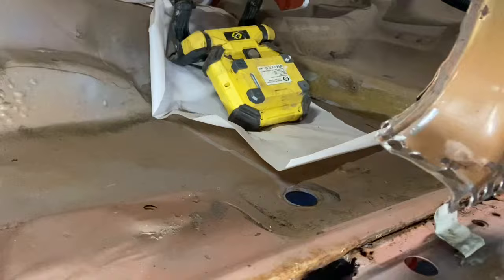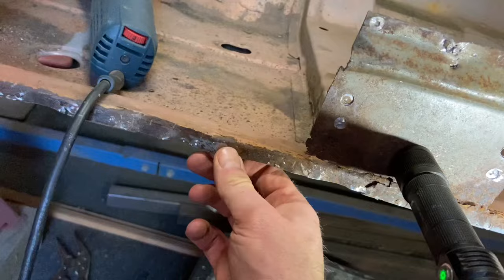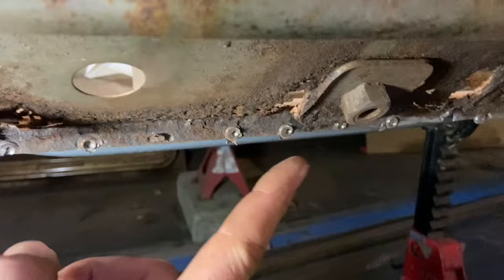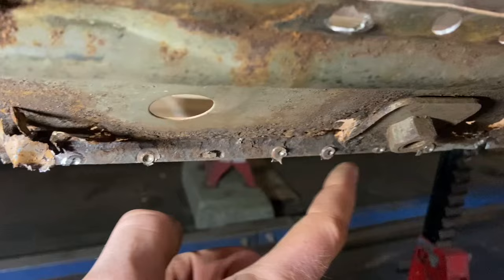Basically what's happened is I've gone along, followed the spot welds from the outer sill onto the floor pan, marked through. But following the spot marks on the inner sill, thinking that that must be the one they use to spot weld the outer to the inner to the floor pan. Turns out not, no. So they were just for the inner to the outer, and it's actually different spot welds